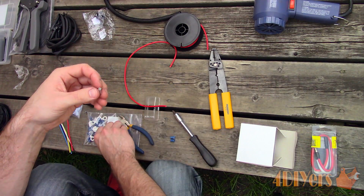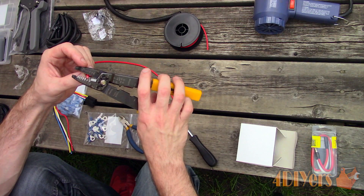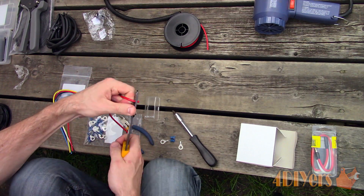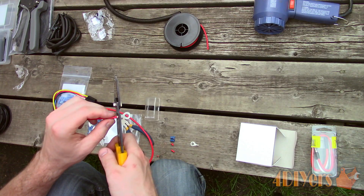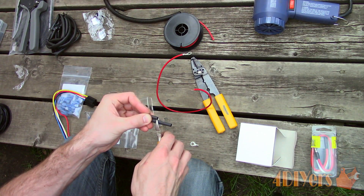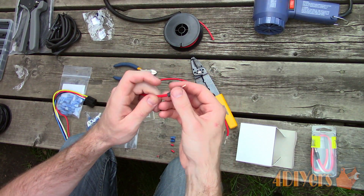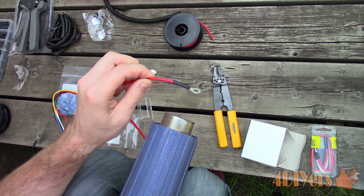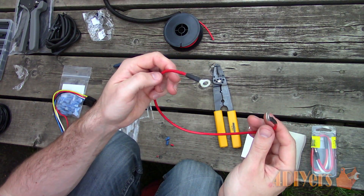Making the main power wire coming from the battery to the fuse box — for this I am using only 12 gauge wire, but if you are powering multiple lights you will need a much heavier gauge wire, otherwise this main wire will overheat and become a hazard. To keep everything tidy I am removing the plastic casing on the crimp connectors using side cutters to pinch the casing, which should stretch it enough to remove. These just simply pull off. The plastic sleeve doesn't always look good when crimped and is too bulky, so I am using adhesive-filled shrink tube instead, which should close up and prevent moisture from getting into the connection.